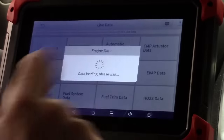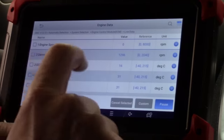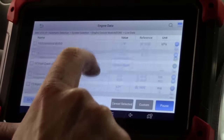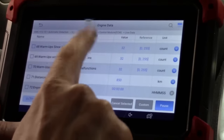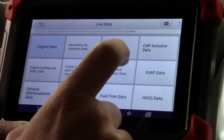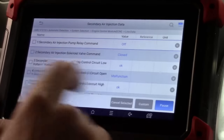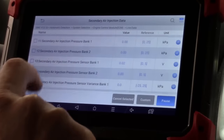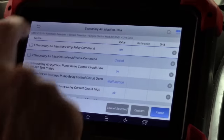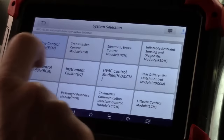Like any other tool, you have tons of live data with lots of categories to simplify fuel testing or various solenoid testing. There are 72 engine parameters right there. You can also specify secondary air injection and control a secondary air pump — very useful.